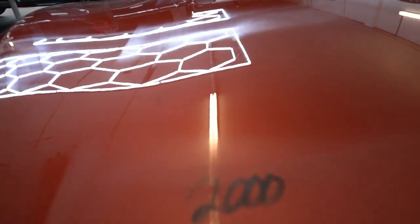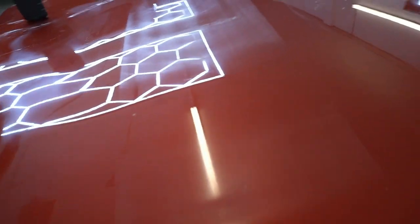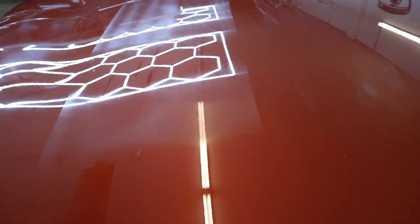So, again, blaze through 2000 grit, 1500 grit, 1200 grit, 1000 grit. Let me get the swirl finder and you'll get a better look in all of these sections. Now with this, you won't get the hazing that you got with the rotary. It takes a little bit longer, but look at that. Look at the crisp reflection of the light. You have that metallic coming through.